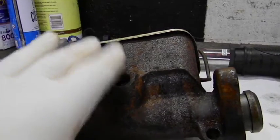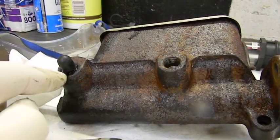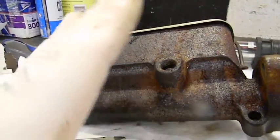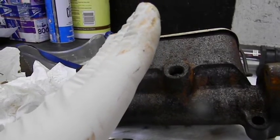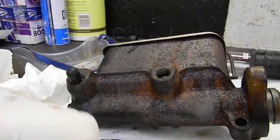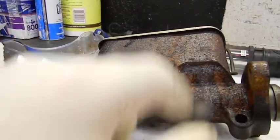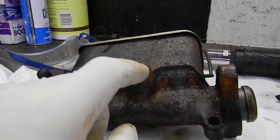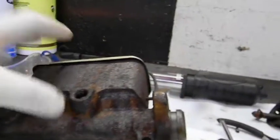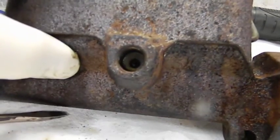When you take your foot off the brake, the fluid tries to go back into the master cylinder through the compensation port. When the lip seal passes, it all bleeds back until it works its way down to about 10 PSI, and that 10 PSI is always on the line. Your front disc brakes — the only thing that releases them is the square-cut seal on the piston, which bows when you apply the brakes and then straightens out and pulls it back. If you left the residual check valve in, the seal doesn't have enough effort to pull back and your brakes drag.